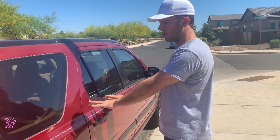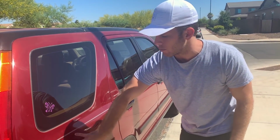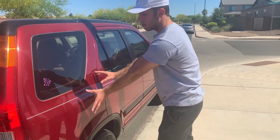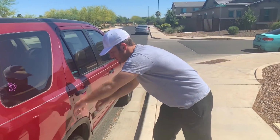First off, do the colors match? Is this red on this panel the same as this panel? When you repaint a car, if this has been hit right here, they will either get a new panel, or Bondo this old panel and then repaint it. And a lot of times it won't match. So, from just visibility, do these colors line up from this door to this door?